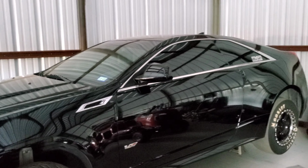So let me tell you guys about the red F-150 SVT Lightning. On the red Lightning, guys, as you saw in the last video, the engine was knocking pretty bad. So I said it might be the rods, something's wrong. And yes, we took out the engine and sent it out, because the guy that sold the engine said he's going to pay for whatever the engine had, so send it to this shop. So we took the engine to that shop, and they were taking care of that. And the guy called us up, he's like, hey man, three of the rods were loose, the crank was burned. I was like, yep, I knew it.